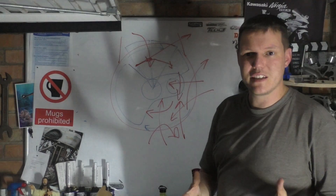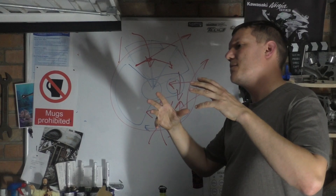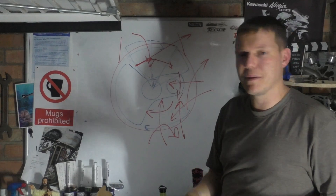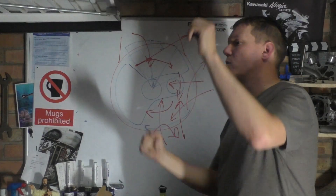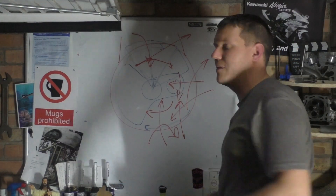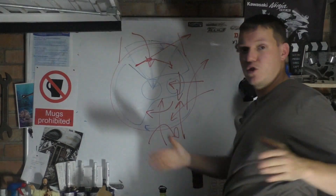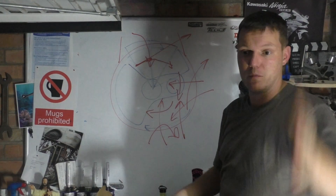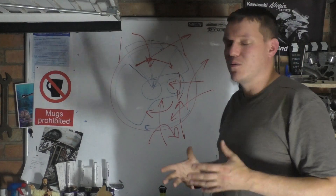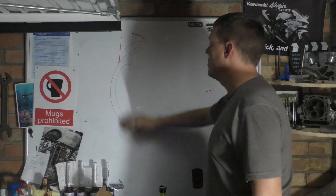You cannot design an aerodynamic form profile of a crankshaft to make it aerodynamic, because the air is pulsing backwards and forwards - one piston going up, one piston going down, air rushing through every which way. It's a complete mess. You'd want your crankshaft to be aerodynamic because you want air to rush efficiently from one cylinder to another - but that's bollocks. It's just complete nonsense. Knife-edging your crankshaft shows no understanding of the system.